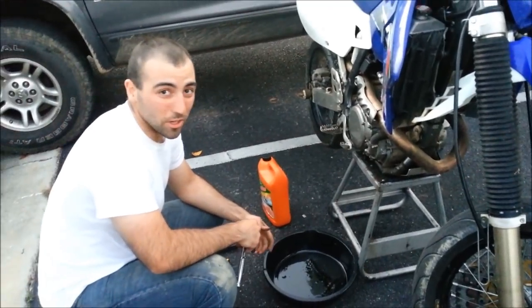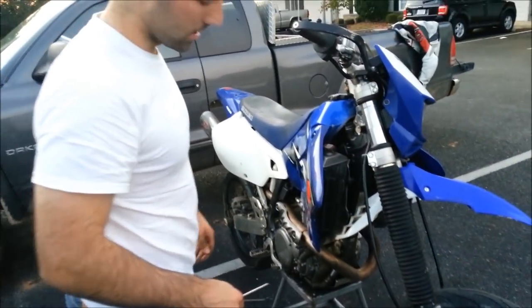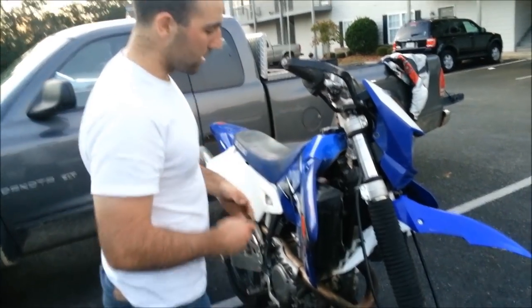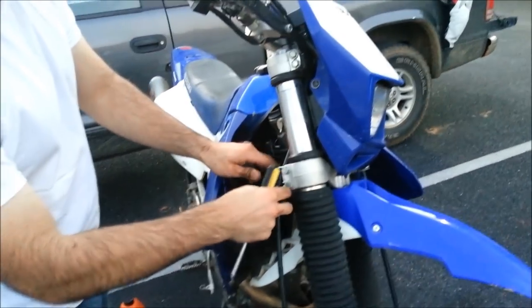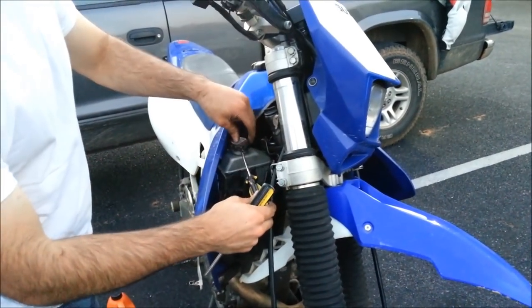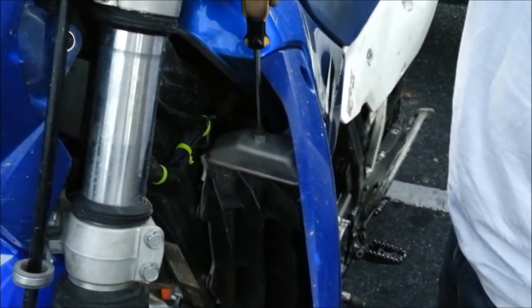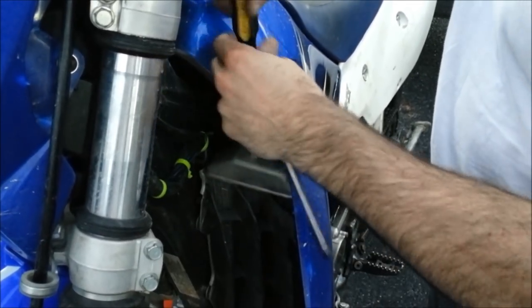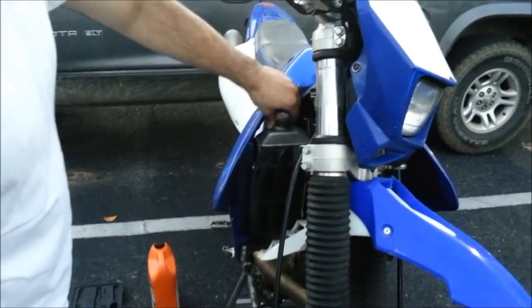Now that we're through that — it takes a little while to get that off, but got it off. The next thing you want to do is take the caps off so it drains a lot easier, otherwise it won't drain as fast — it'll be like a straw effect. There's a little retaining screw that'll allow the cap to rotate. There's also a pressure release screw right here — just let that out slightly to release some of the pressure. Once you stop hearing that hiss, go ahead and take that out all the way. This will allow you to fill it up a lot easier as well. Take that screw out and make sure you don't lose it — there's going to be a small washer on there as well. Now take your radiator cap off now that your pressure's released.